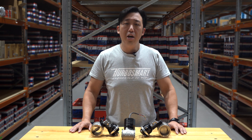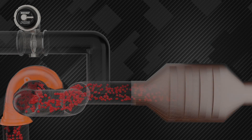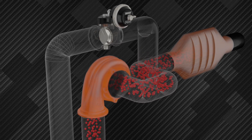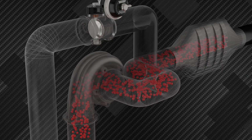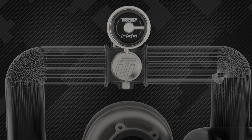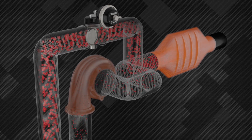Why is this beneficial? An important emission control device on a car is a catalytic converter, also known as a CAT. The CAT works by burning particular gases from combustion to reduce the harmfulness of the exhaust gas. For the CAT to function it needs to be at a certain temperature. During cold startup it will take time for the CAT to reach operating temperature, and the only thing heating it up is the exhaust gas. Not only is the CAT absorbing heat energy from the exhaust, but also the turbocharger, as the exhaust gas needs to flow through the turbine before reaching the CAT. A vacuum actuated straight gate can be manipulated to be open during cold startup, allowing more exhaust heat energy to bypass the turbine and enter the CAT, aiding in reducing the time it takes to heat up the CAT, effectively reducing the amount of harmful emissions from the engine.